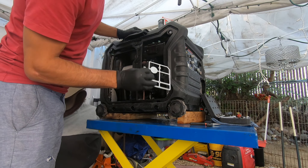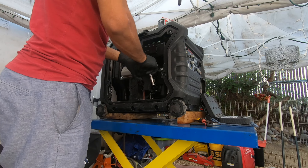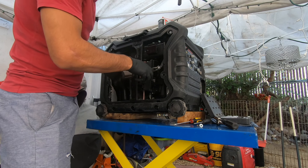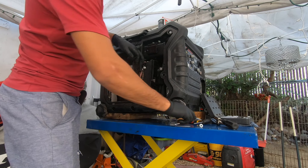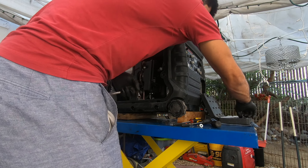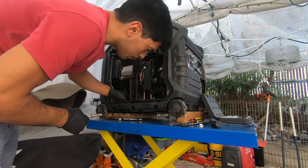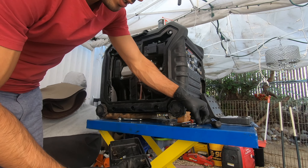There's a metal piece here so the filter doesn't get sucked into the carburetor. For the carburetor, as usual, it's a 10-millimeter socket fastened by two screws — sometimes the airbox has a third one on the bottom. That hose goes to the crankcase behind the box, and this one does have another screw from behind, so I'm going to need an extension for it. Here's the airbox — it's got a little bit of sand inside, which is concerning.